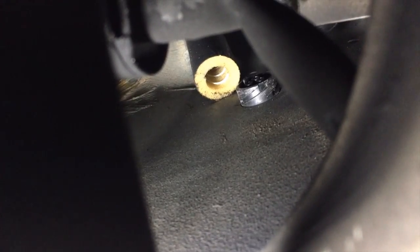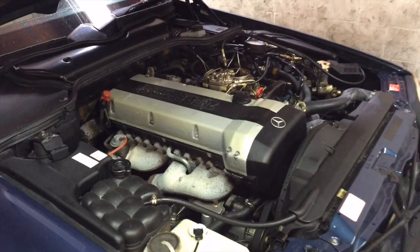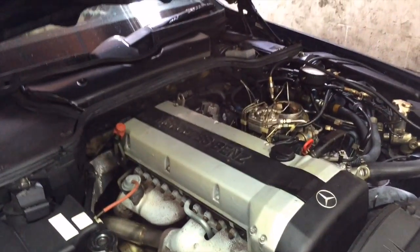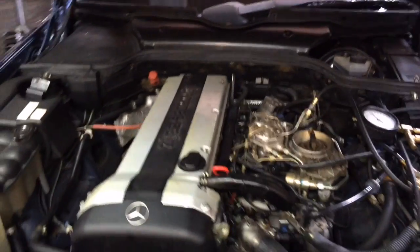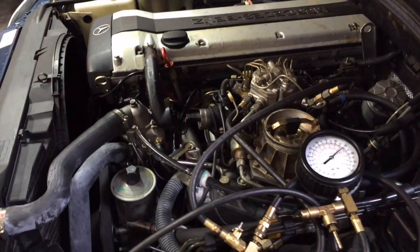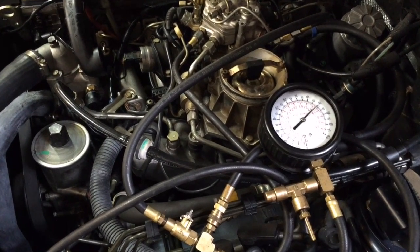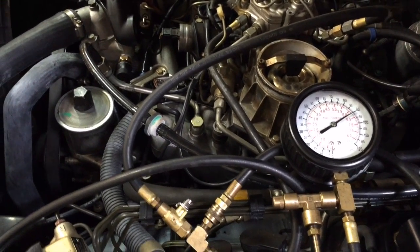You can see the fuel pressure gauges on the 300SL. The way I know that the new oxygen sensor is helping is because of a before and after result. My before result was an operating pressure of 6.3 bar with an oscillation of about 0.1 bar. Now I'm at 6.2 bar, which essentially means my mixture is a little bit richer, and an oscillation of about 0.2 bar on my needle — showing that the engine computer is actually reading the input from the oxygen sensor and turning it into a viable result, which you can see in the minute movements of the fuel pressure gauge.